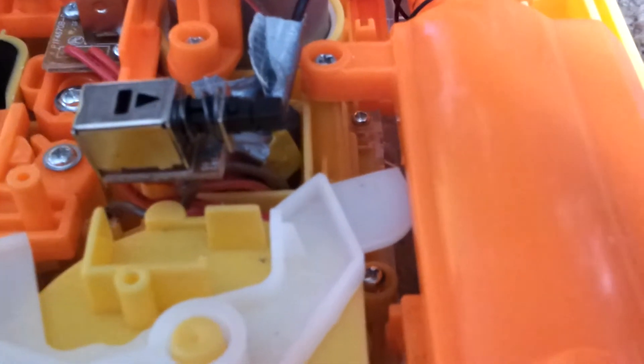This is the main switch that I'll be using here, and it really doesn't come out on camera, but all I did was nest the two springs together into that one switch. Now when it's underneath the white lever, it exerts twice as much force — that does mean a heavier trigger pull, which makes sense. But now that should solve the problem of runaways with overvolting the Stampede.